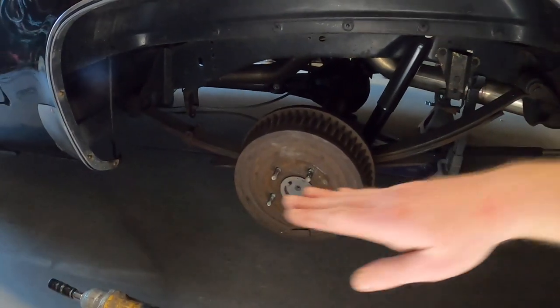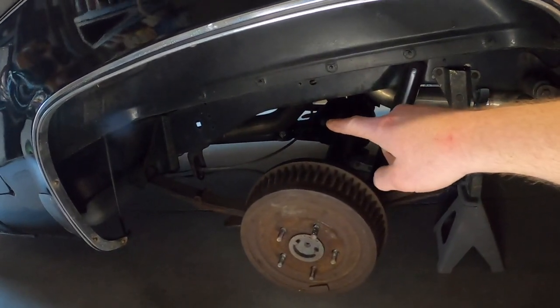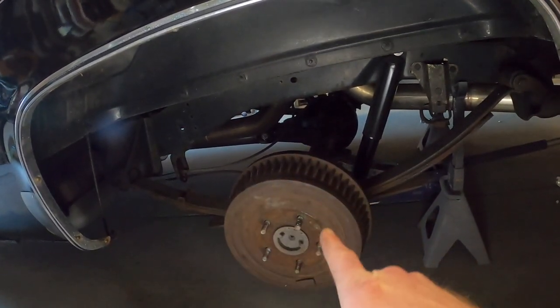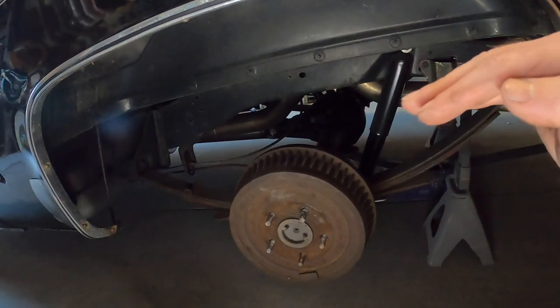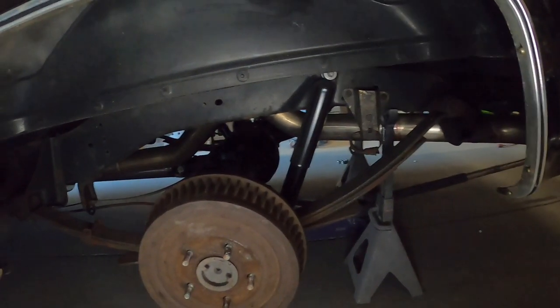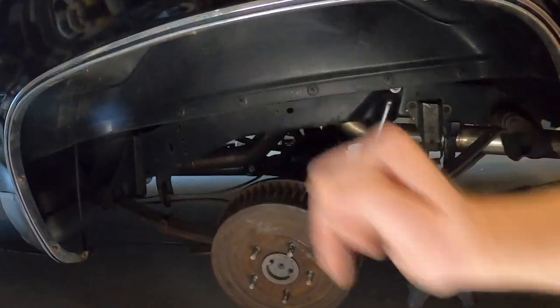So obviously, leaf spring, right? Differential in there, drive shaft, obviously. So what happens, as the wheel goes forward, it wants to push the pinion up. That's fine. You ease out of the clutch and it does its thing, and the shackle back here articulates and gives it a little bit of give and it goes down the road.